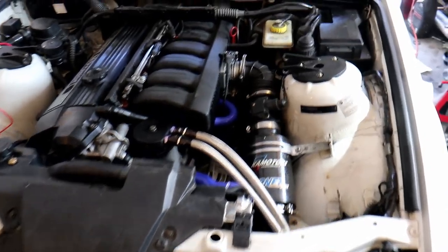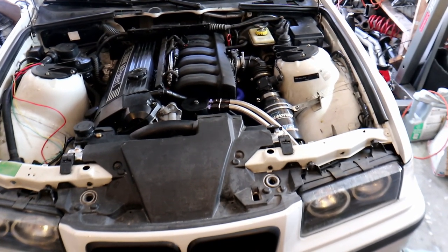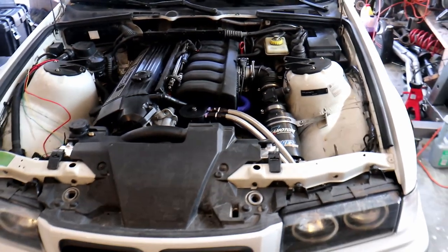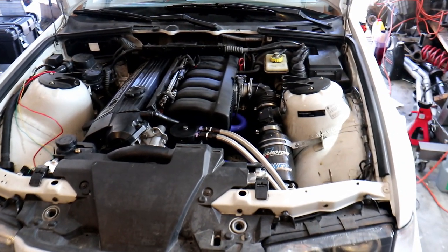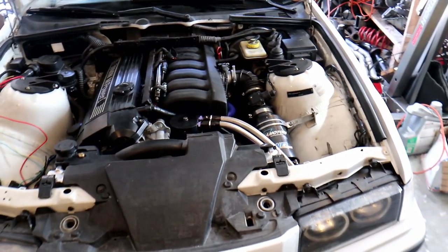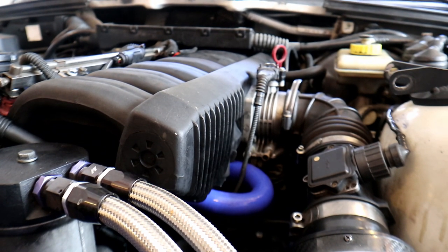Our M50 manifold swap is done — going to reinstall the upper cowl and put the strut brace back on. A couple things to note: on initial fire-up it should run fine and idle well. If it doesn't, you have a vacuum leak or something else might be unplugged — check that out. It should also not throw a check engine light after the conversion if done properly. If the check engine light is on, you might have a vacuum leak or something plugged in incorrectly or not at all — double check your work. Thank you guys so much for watching, keep it fresh, enjoy your newly acquired ponies, and I will see you guys later.